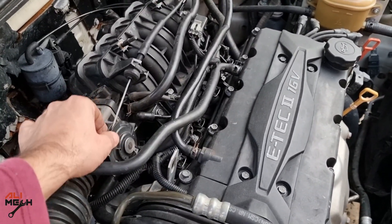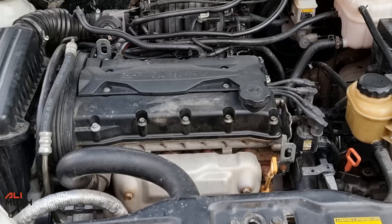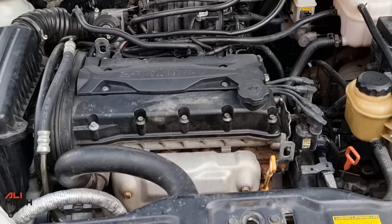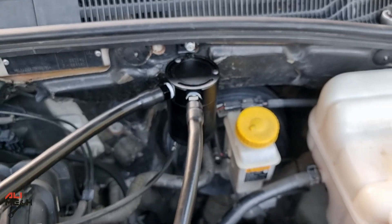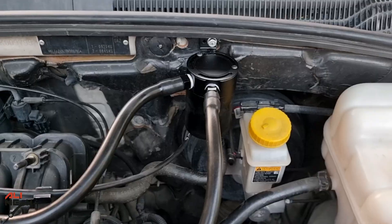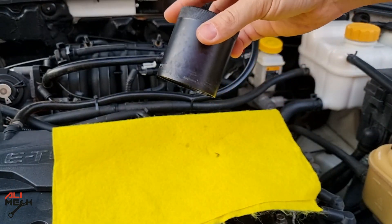The engine is warmed up now and has no lagging. After taking the car for a test drive, I could feel the engine gain power. I won't have heavy carbon buildup again because since I installed the oil catch can, the intake manifold is dry and oil free. If you haven't watched that video, I will put the link in the description box below showing how I installed the oil catch can and how much oil it's catching.